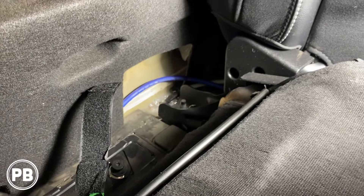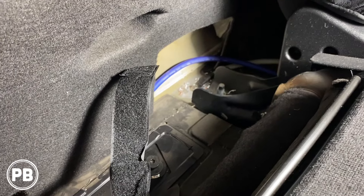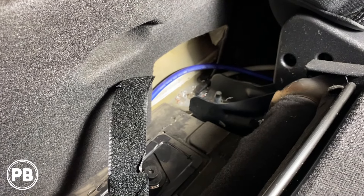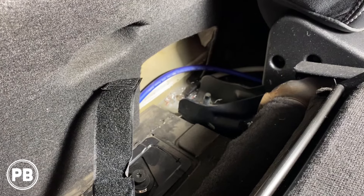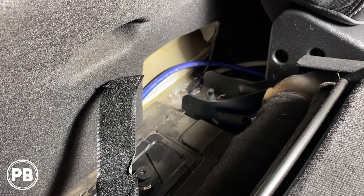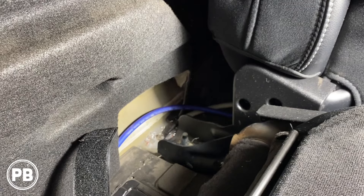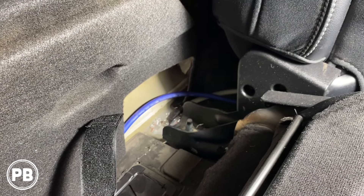Considering grounds on these F-150s — the body is made of aluminum, not steel, in this generation. In our other version we actually ran an additional OFC wire from the back all the way to the battery ground. If you feel you need to do that or are having continuity issues, go ahead — we'll link that in the description. In this case, we're not running one and will see how the amplifier performs; if we're struggling, we'll upgrade our ground. With power and ground done, we'll vacuum up metal shavings and then pull the radio to plan our RCA, T-harness integration, and line-out converter with load generators.